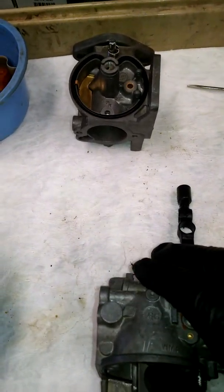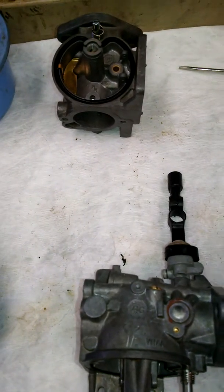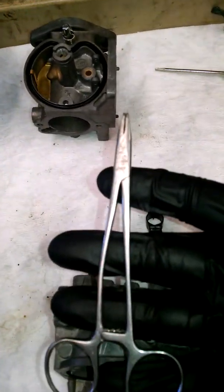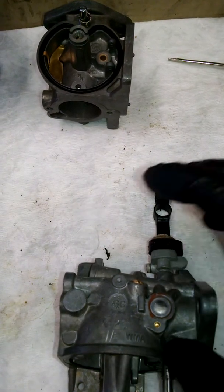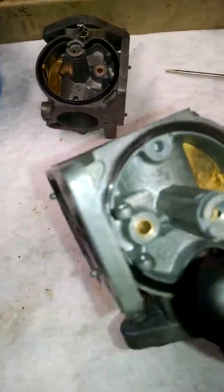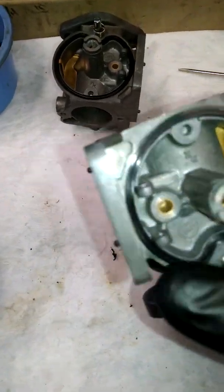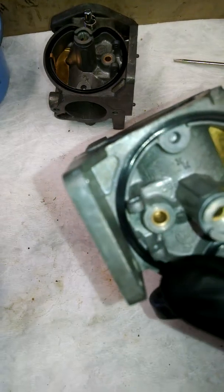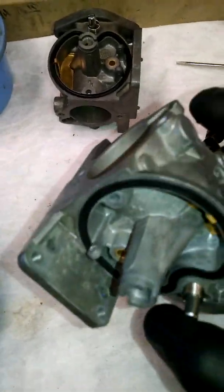Video ended on me while I was getting this ready, but I took a little piece of Scotch-Brite and used hemostats, put them in the seats, spun them, cleaned them. This one, number two, has definitely got something cut in there — it's almost like somebody took a drill bit to it. That kind of ticks me off because this may or may not seal properly, and the only way to find out is to put it together.